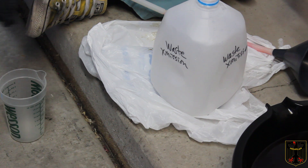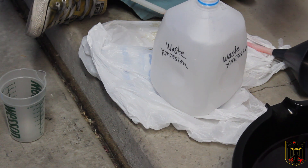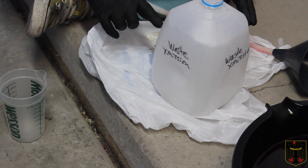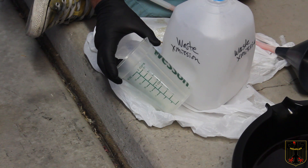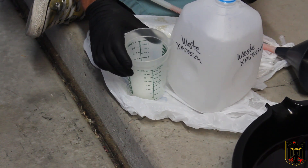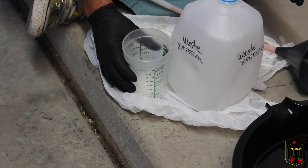The new plug went in very nice and snug, so that's good. I could feel the crush washer crush and everything was good. Now I need to take this measuring cup and measure the fluid I took out and put it into a waste container marked 'used transmission fluid.' I need to get the exact count on how many quarts or partial quarts to put back in.